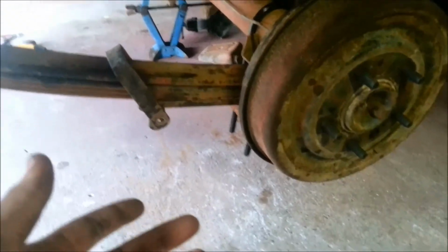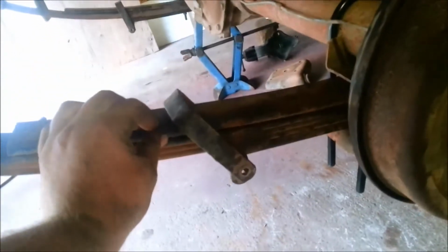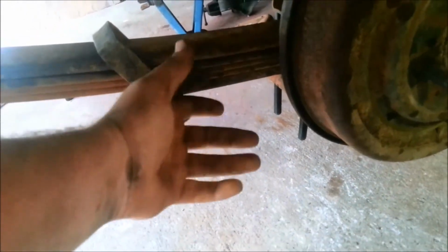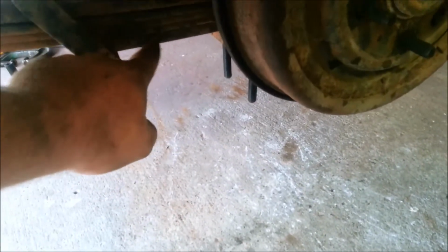I want just a little bit low, but my shock travel back. And with taking those 3 thick leaves out, because they're about half an inch thick, I've gained an inch and a half worth of my travel on the shock, because I've brought that lower plate up. So actually no, I've only gained an inch because I put one back in.